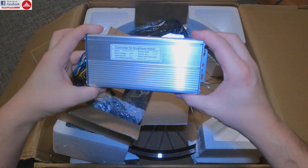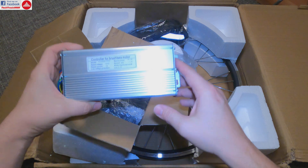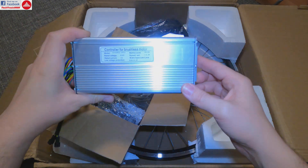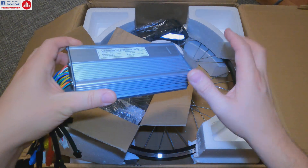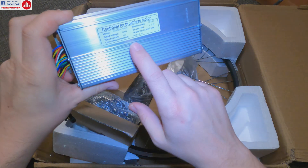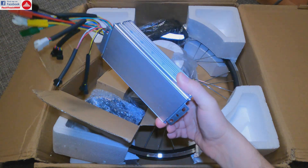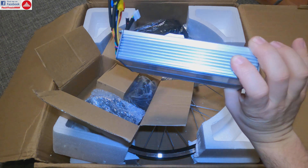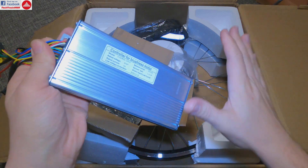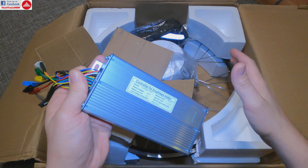You also get a band to put inside the wheel so your inner tube won't be damaged by the spokes. Then there's the controller, which is huge in this case. This motor kit is 1000 watts rated at 48 volts, and the controller has a maximum output current of 30 amps — roughly about 1500 watts instant power. Nominal power is 15 amps, so it can deliver a lot more juice when you accelerate.